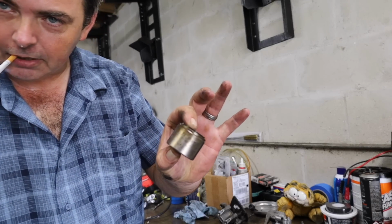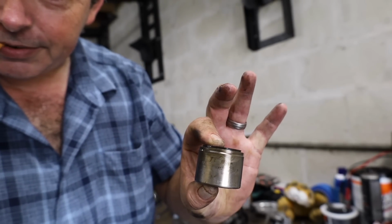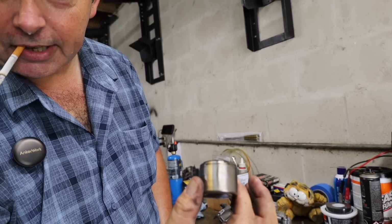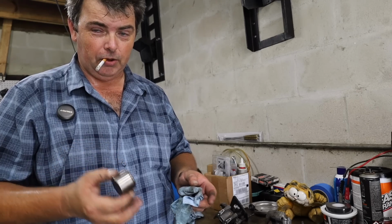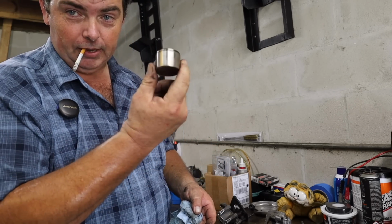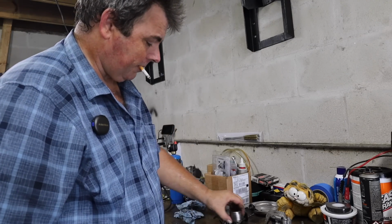And yeah, I know it looks gross right now, but so that's what we started with. That's what we got right now. And there's how it polishes up. Clean and smooth. Now all we got to do is spray it off with a little bit of brake cleaner, get it dry, get all the oils off of it, and we're ready to go back together with this. Told you, it's boring. That guy's ready to go back together.